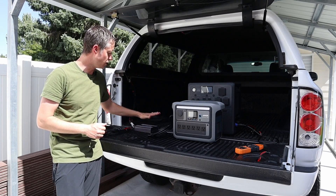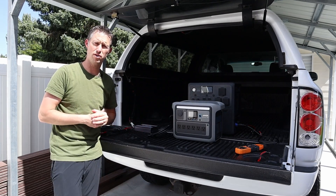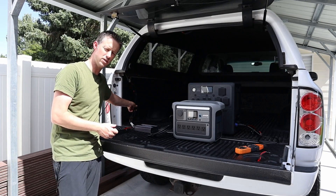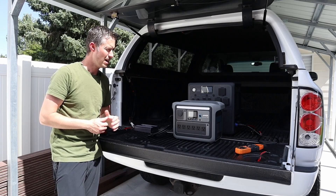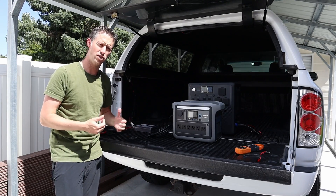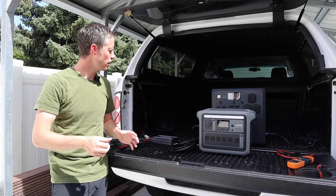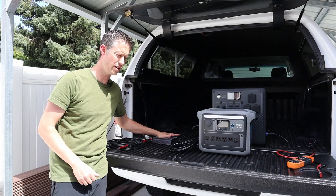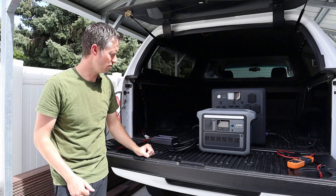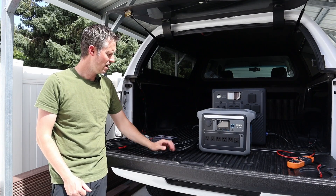I've been letting this run a bit longer. I reduced the charging speed on the converter down to 300 watts from the alternator, and it seems to prioritize solar input first, then fills in the rest with the alternator charging. For example, I measured about 16 amps coming from the wires at 13 volts — that's around 200 watts — and we were getting around 300 watts from the solar panel, giving us 500 watts total. Even though I have it set to 300 watts on the converter, it's only pulling 200 watts from the alternator, and the rest is coming from solar. After shutting off the truck, it stopped pulling from the alternator and is now just getting around 250 watts from solar, confirming that turning off your engine stops alternator draw and the unit continues charging from solar.